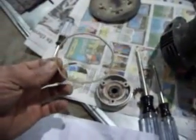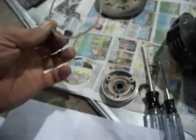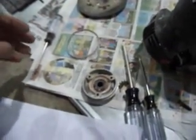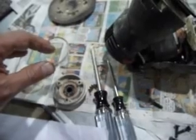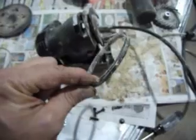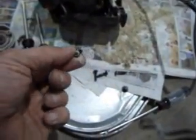Also you might want to have an extra one of these. I'm on my second belt as well. So you take that off, and then you'll be able to access the 2 screws, which you can see the holes for here, underneath this sealer O-ring, which you have to pry out of that groove. And then there's a couple more screws just like this, holding the rest of the case together.